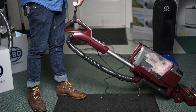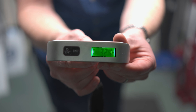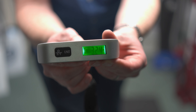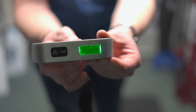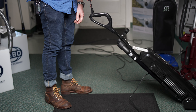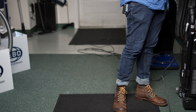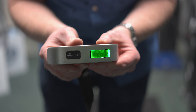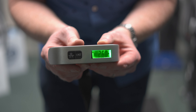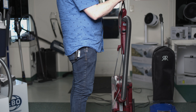The handle weight is high on this machine, clocking in at 3.25 pounds. As we've discussed in previous videos, handle weight is one of the most preventable forms of exertion when vacuuming. The heavier the handle is, the harder the machine will be to maneuver, and the quicker you will tire. Compared to the Riccar R25S, which comes in at 2.6 pounds in a heavier overall machine, the Shark shows it's continuing with high center of gravity designs that put more weight of the motor on the user's arm. If you have back, shoulder, neck, or elbow problems, you'll likely want to look elsewhere.